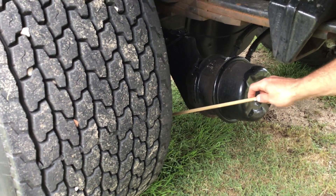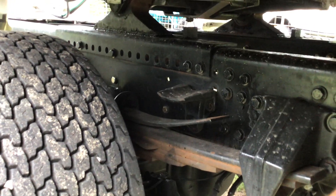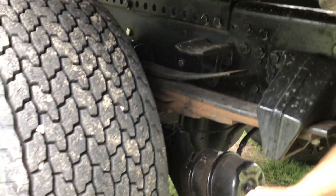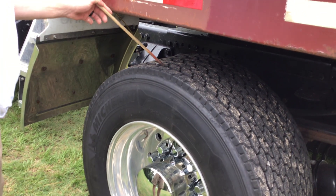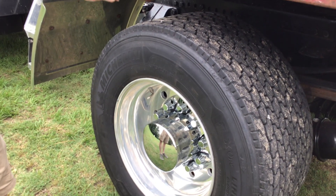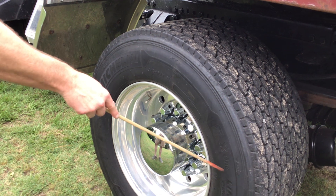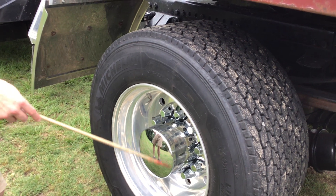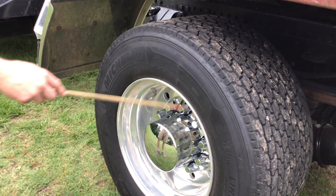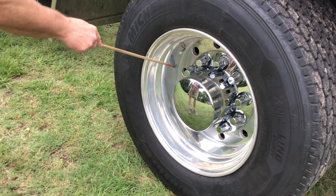My inner wheel is properly mounted and secured. It's not cracked, bent, or broken, and it's free from illegal welds. My inner tire wall has no abrasions, bulges, or cuts. It's properly seated to my inner wheel. This tire has more than 2/32nds of an inch tread depth — to check the tread depth you'd use a tire tread depth gauge. The tire is evenly worn with no abrasions, bulges, or cuts. The outer tire wall is properly mounted and seated to the outside of the wheel with no abrasions, bulges, or cuts. This tire has 100 psi of air pressure. My valve stem is properly mounted and secured. All nuts and bolts are present and tight. It's not cracked, bent, or broken, and it's not leaking.